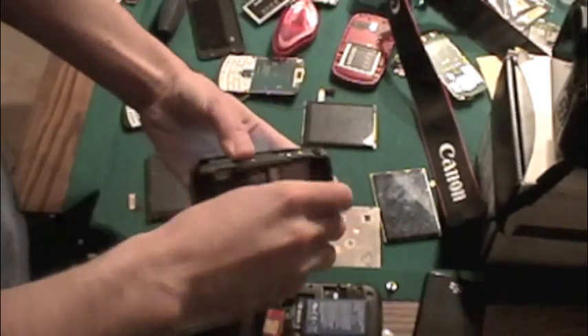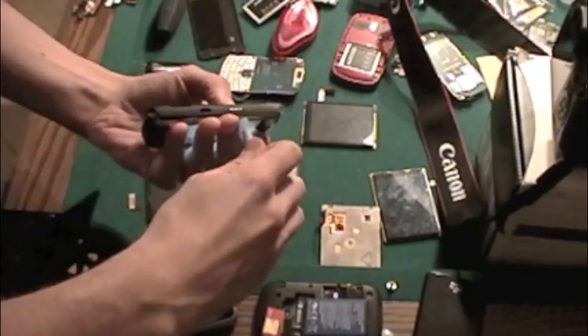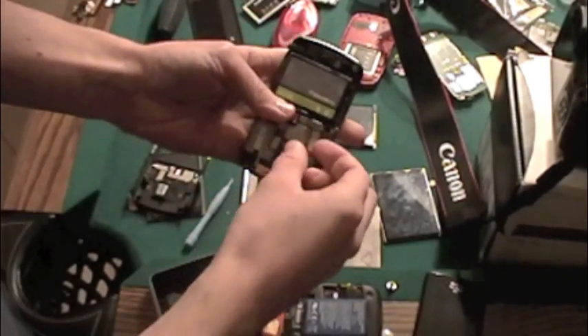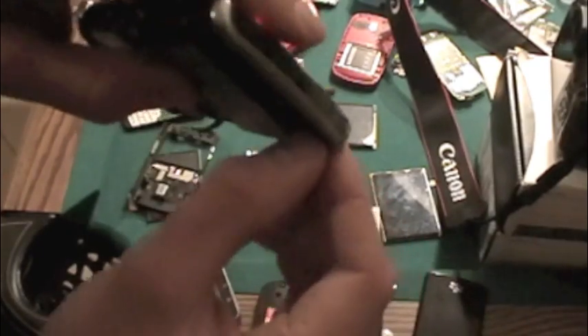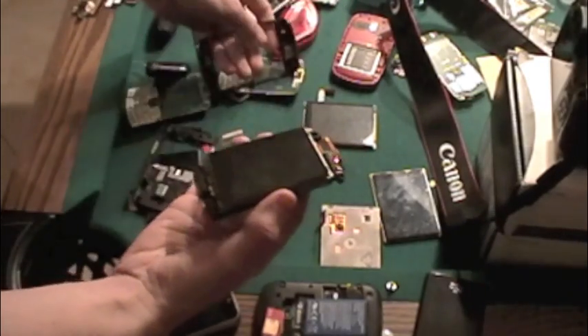Be careful though. Pop the LCD connector — pop that off. Make sure you get that bottle cap cable off. It's just what I've heard it called, so that's what I'm going to call it. Then lift the front off the phone. LCD off.